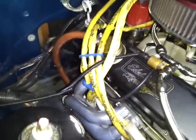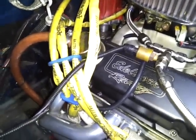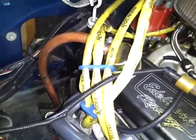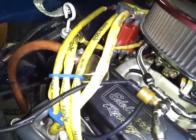This is neat — I just did this a little while ago. I put the Moroso crankcase evacuation system on it. You can see the breather right there. It connects to a heater hose, then goes down into a check valve and into my exhaust. I'm also doing the same thing on the other side, but haven't got to it yet.